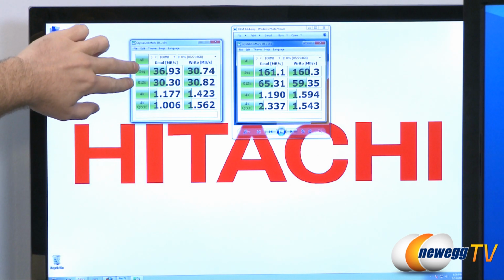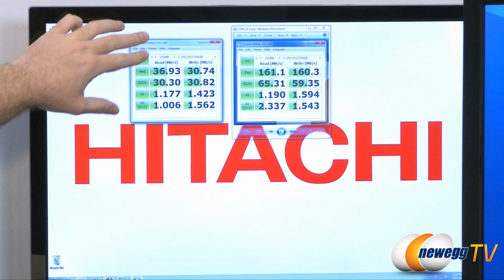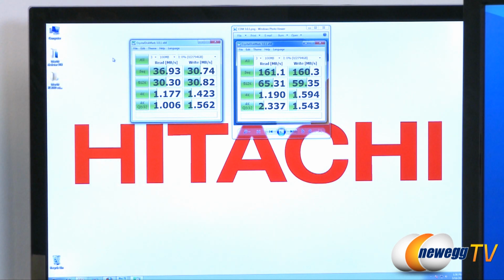The reason these numbers are showing those values is simply because this is connecting via USB 2.0. That's pretty much saturating the bandwidth. That's about as fast as that can communicate between the computer and the external hard drive.